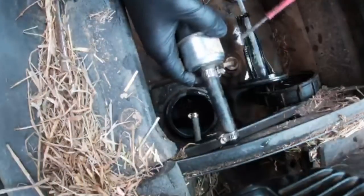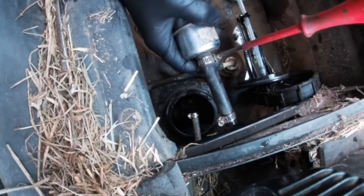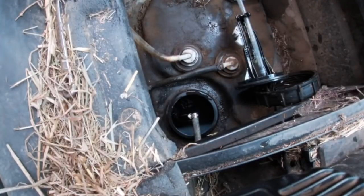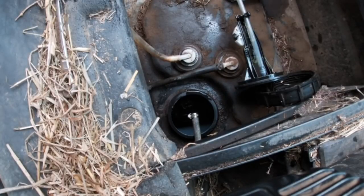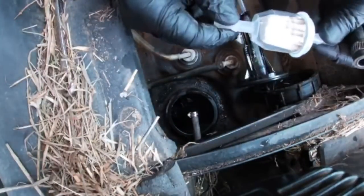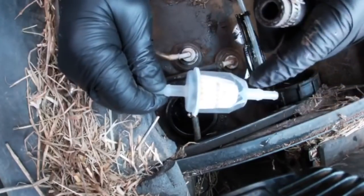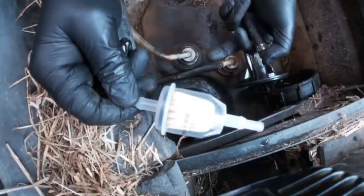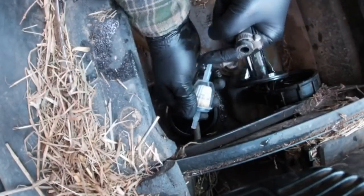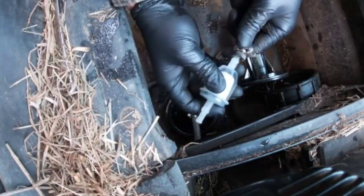So take this plate off here. Get the new one. Right, on these, not that I'm teaching anyone to suck eggs, make sure you get your flow right. So, arrow here, so your flow will be coming up from the tank, so the arrow will be facing that way, going up around into the fuel pump, then into the fuel filter. So connect that one.